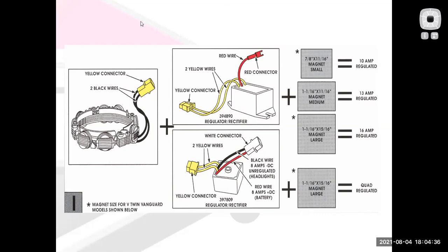A typical charging system voltage, whether it's a car or a small engine like a riding lawnmower that still uses a 12 volt battery, is when it's running, I want to see somewhere between 13.8 to maybe 14.8 volts, because that's the charging system charging that 12 volt battery. A fully charged 12 volt battery is really going to be, if you measure the voltage on a battery and it's sitting there at 12, it's actually at 50% state of charge.